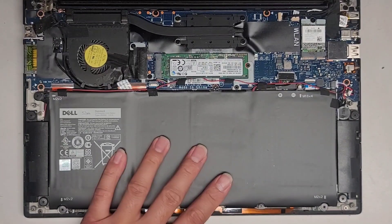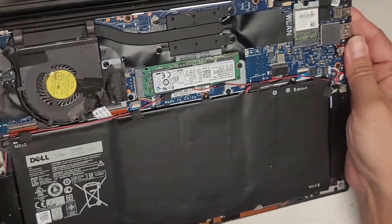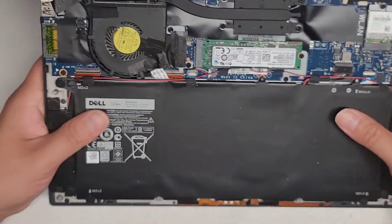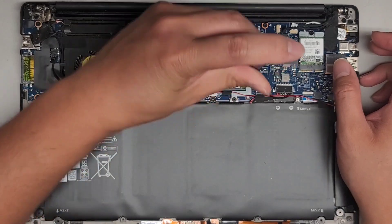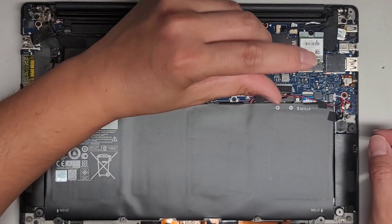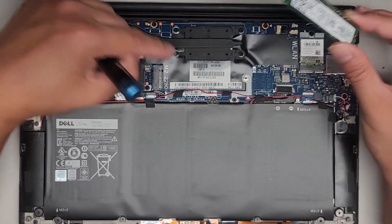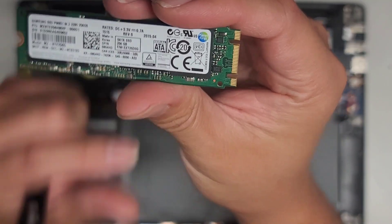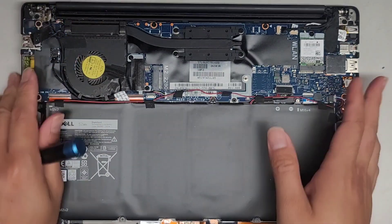The customer just wants to retrieve their data, so we're going to pull the SSD out. I don't see any sign of upgradable RAM or anything here. We are going to remove the SSD — this is a M.2 SATA. This isn't a PCIe NVMe. I'm not sure if this motherboard supports PCIe NVMe SSDs, but this is the M.2 SATA SSD. You can see it has two notches and it says Serial ATA. We're going to set that aside.